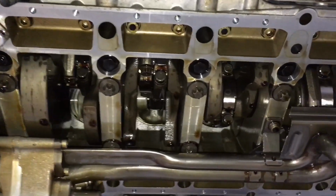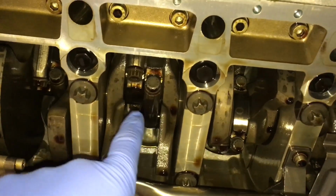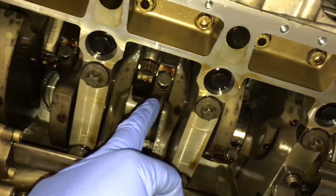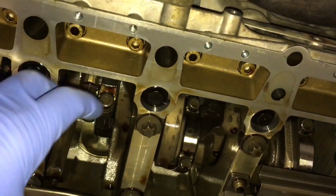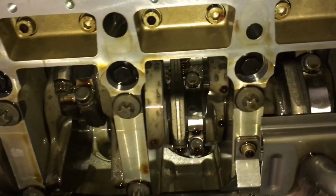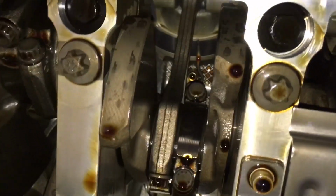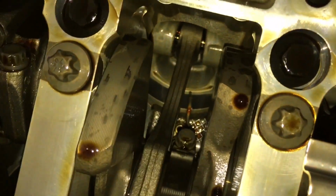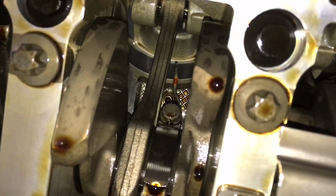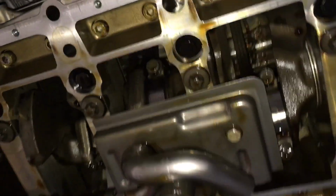And now you can see up into the engine block, you can see the pistons in the distance, the connecting rods here, and these are the Conrod bolts, and the bearings are inside, wrapped around. Well, they're actually sat in the Conrod and Conrod cap, but they're designed to sit around the crankshaft journal, and they float on a film of oil. This is a nice view of the Conrod just here, and looking up to see the piston, and also see the oil piston squirters up in the distance, which we're going to be changing for the new design on this job as well.